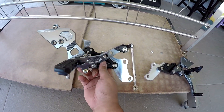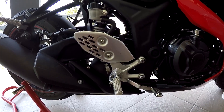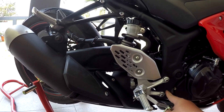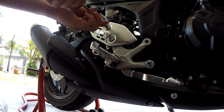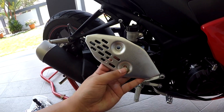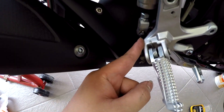Right now I want to install the brake first. The brake is the most difficult part. I'll show you guys how to do it. Firstly you need to unplug this screw - one, two, three, four. Remember to direct this thing. After you take out this bracket, this bracket is mounted with the brake pump together, and then take out the pin here.